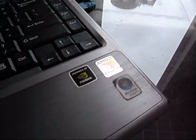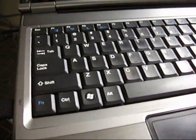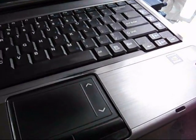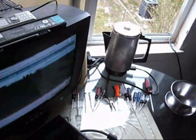What I'm going to do is take her apart to clean her out. I'll pull the keyboard out to get to the fans and really dismantle the whole thing. I'm going to take all the cards out and all that stuff. I've been running it without the battery, thinking that maybe it would get more ventilation.